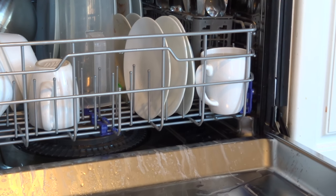The reason you do this is because dishwashers, when you start them up — many of them, not all but most — go through a drainage cycle first. So the pump will run, and if you poured vinegar in there it's just going to suck all the vinegar out and it's not going to do anything. So that's the key: use a cup, put it in there, do not pour it into the dishwasher.